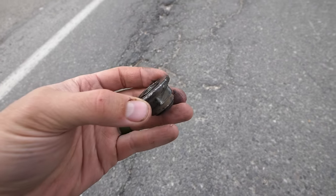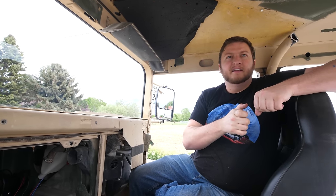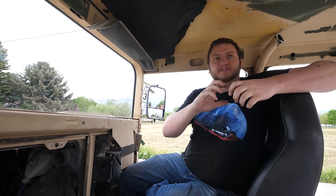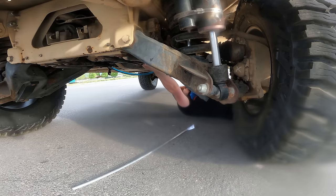It's still hot — way hot. My theory is the splines on the yoke are too big. So it went together, cinched it with the nut, and that was holding enough friction to drive. As you drove, it would slip a little bit, but when it was slipping it was tightening the nut, until it just cinched it right off.